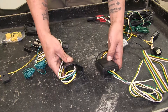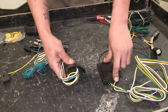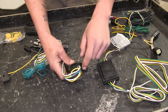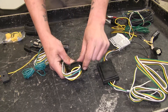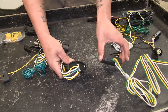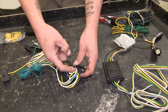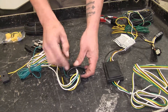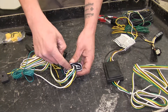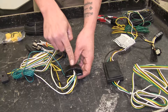The main difference besides the shape and look of our module boxes is the way they're constructed. Both use surface mount technology for mounting the circuit boards, but the main benefit on the Tekonsha is this epoxy — a shiny potting material — whereas the Curt is just a plain plastic box. This potting material helps keep out moisture and debris from getting inside our circuits, and when mounted over rough terrain, the epoxy absorbs vibrations and keeps stress away from the circuits inside the module.